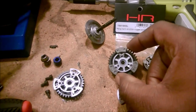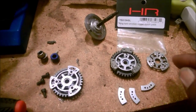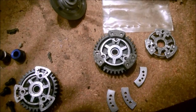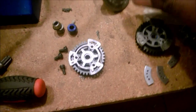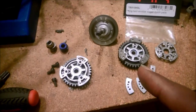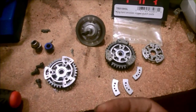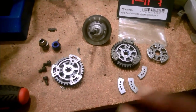This one here is the upgraded E-Revo size slipper — you can see the size of the pads. And these are the extended Hot Racing aluminum pads; you can see right here the difference in size. The idea is that it increases your surface area, and with the metal-on-metal contact on the friction surfaces plus the larger surface area, you get more grab so you can put more power to the ground with less slip on the slipper clutch.